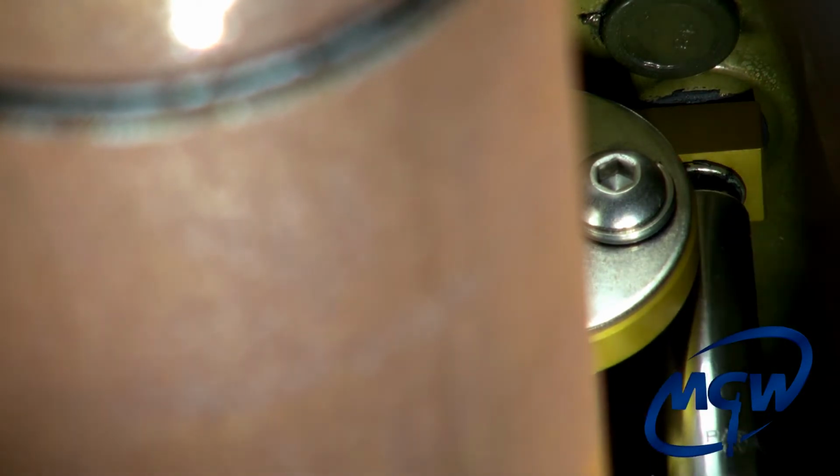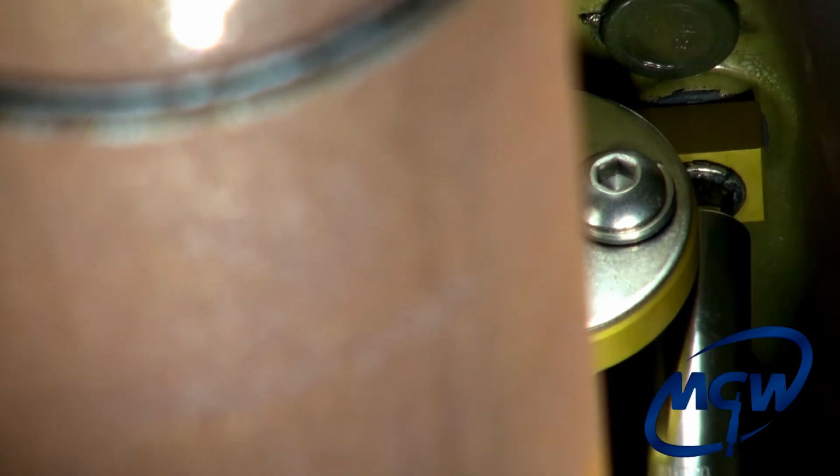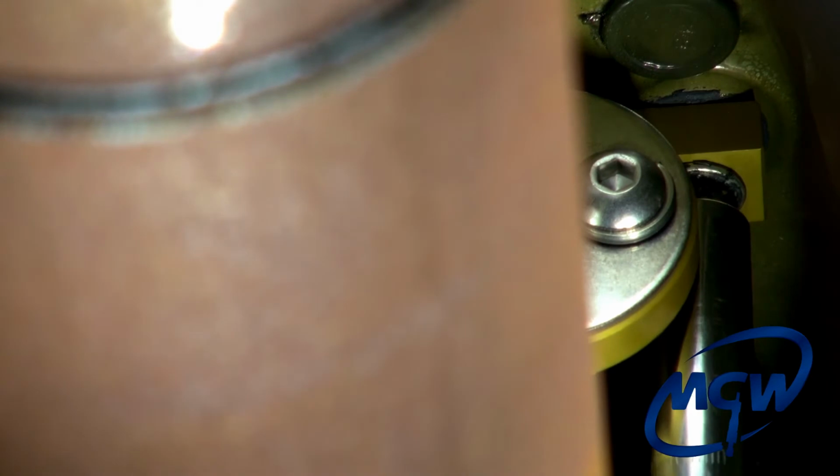One thing to keep in mind when you're tightening the nylon lock nuts is do not let the deep well socket go around both nuts at the same time, because you'll jam the one that's already snug too tight and you may strip it. Back it off a little bit and make sure that you're only turning the nylon lock nut, because you could easily get them both lined up with the flats and go over both of them and it'll feel like it's tight, but you're actually only tightening one of them.